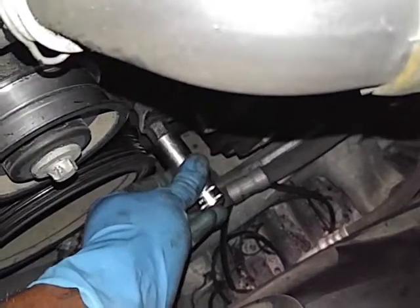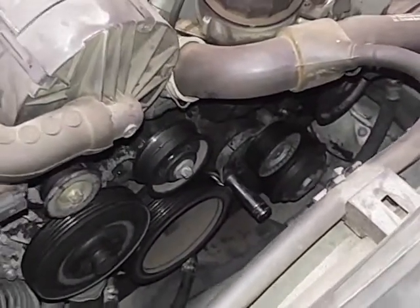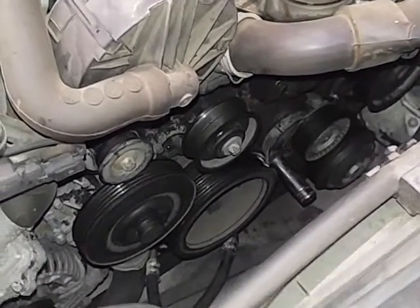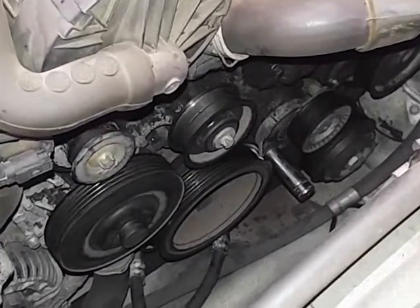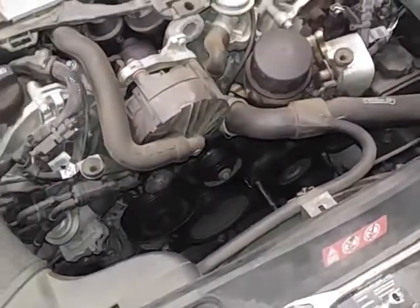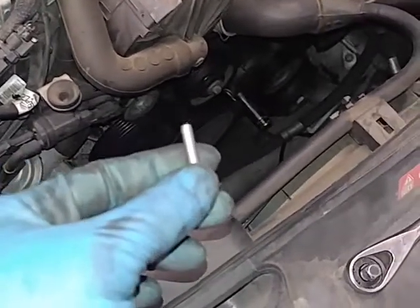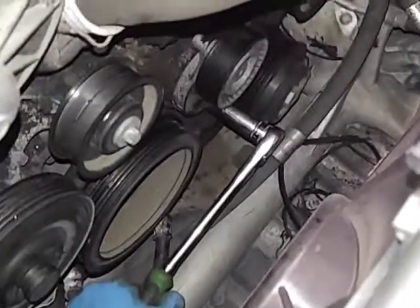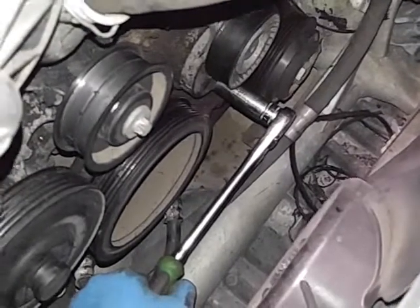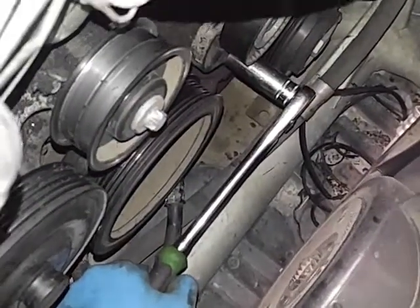Place the size 17 right here. No matter what, to get to the second screw of the tensioner, you're gonna have to push down and put this pin to hold the tensioner in place so you can get to the second bolt, which is underneath the pulley. Size 17 holds the tensioner, and once you do that, place this pin which holds it in position. Now the pin is in the tensioner — when I release the ratchet it doesn't even move because the pin holds it in place.